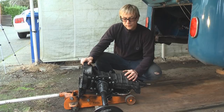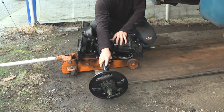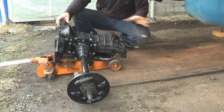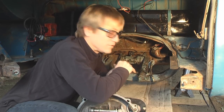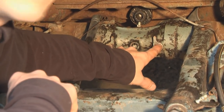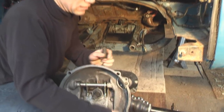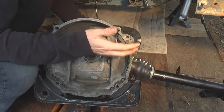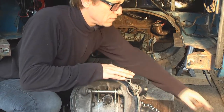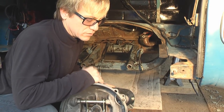We're here at the transmission. There are four places where this transmission mounts to the bus: the end of your swing axles, which attach to the spring plates we put in; your rear engine mounts; your front engine mount; and your shift coupler. I keep calling them motor mounts, but they're on the transmission because Volkswagen is one of those odd designs where the engine is actually bolted onto the transmission. The engine doesn't have any motor mounts — it relies on the transmission suspension points to keep everything hooked up and stable, which is why the engines come out so quickly.